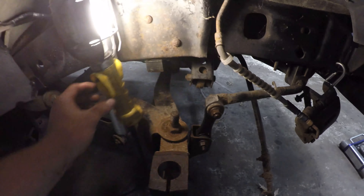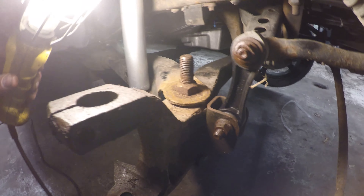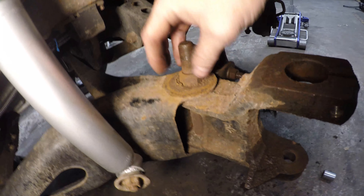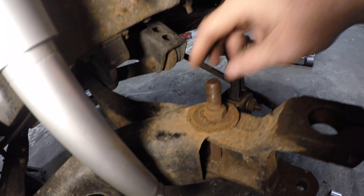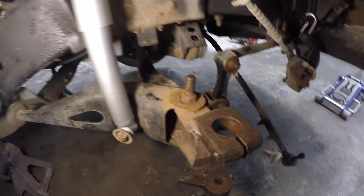All right, I got the spring out — got that nut off the stud there, which is actually a bolt that runs all the way through that arm. Now there's another nut on there. On this nut there's like a little washer, then a little isolator, and then the spring sits down on top of it — there's like a conical washer and then a nut, and that's what holds the spring in place. Kind of a weird design, but apparently it works.